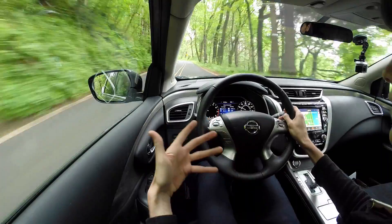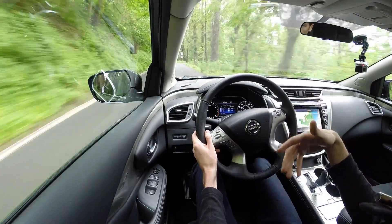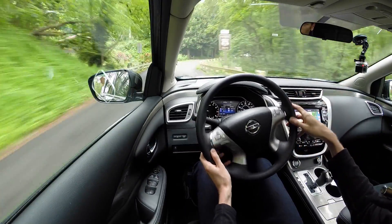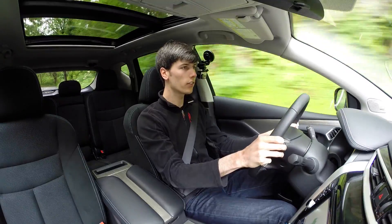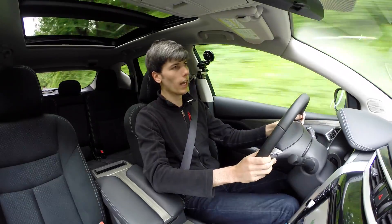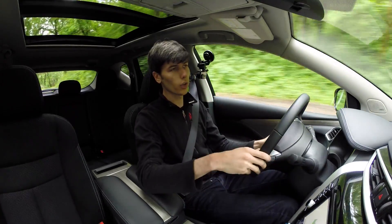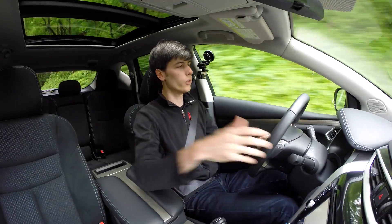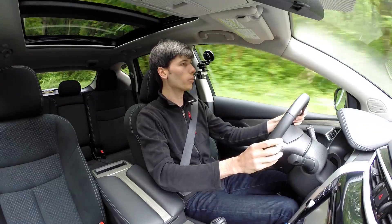The seats are super comfortable, the suspension is really soft, the interior is very quiet, and the steering is effortless — the whole experience is a comfortable, point A to point B commute done very well. The CVT does act somewhat like an automatic transmission, stepping between certain gear ratios. It can also provide engine braking, and using the manual selection mode on the selector you can engage a higher gear ratio going downhill instead of relying on the brakes.